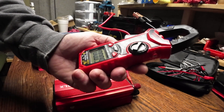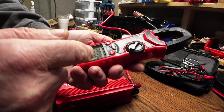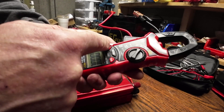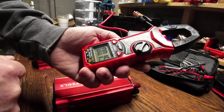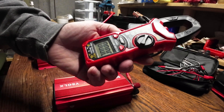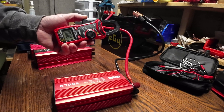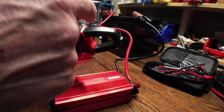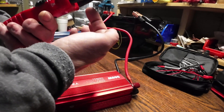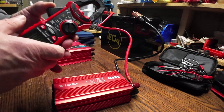To start out, your amp meter has to be able to do DC as well. On mine I can change it from AC to DC by pressing certain buttons — in this case we're going to go to DC and then zero it out by holding that button in. For purposes of this test, depending on which direction the clamp faces, you'll get either a negative or positive reading — it doesn't really matter for our testing purposes which direction the current is going in.